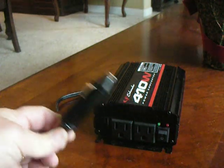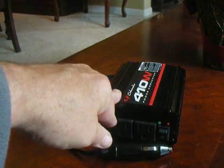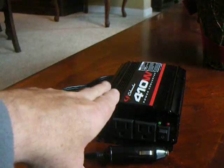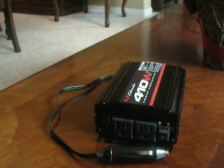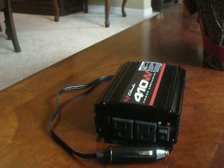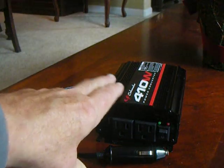By using a separate battery, the worst thing that could happen is your lights could go dead or dim, and you still would have power to get you back home. So if you have a separate battery laying around — in a boat, a recreational vehicle, an unused car — something that's in good condition that you can charge up, then that's the way to go.